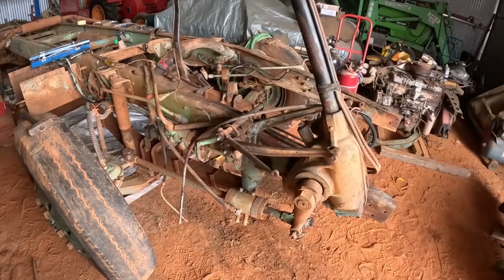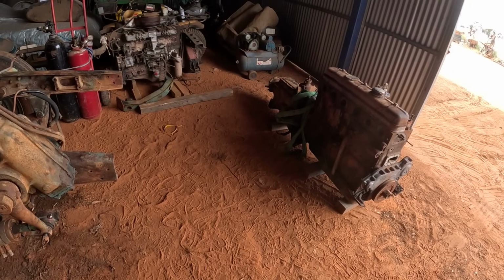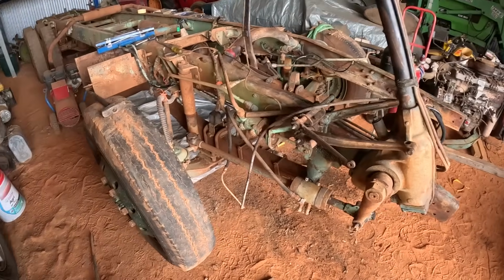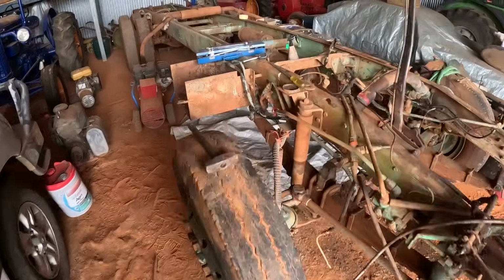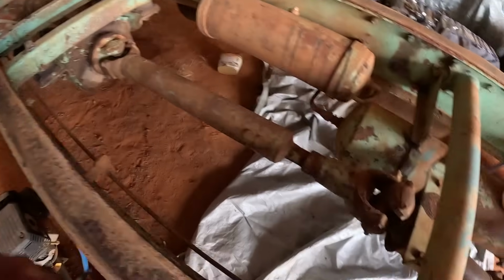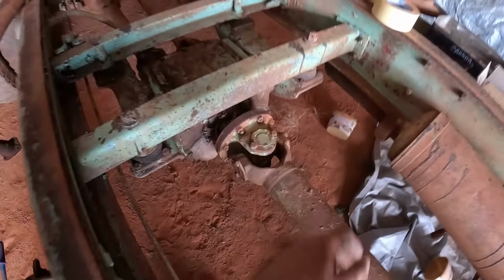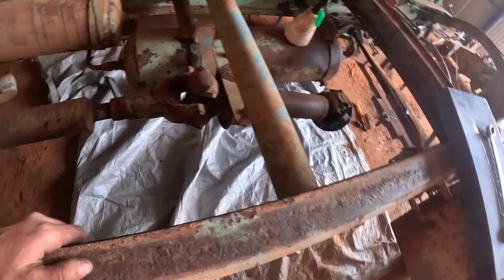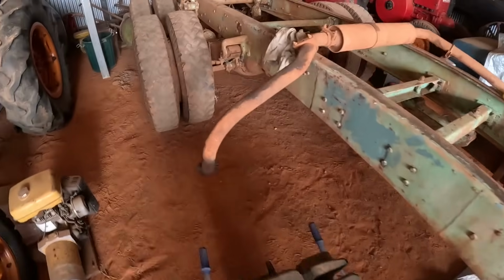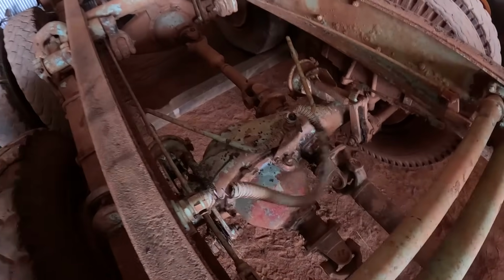I don't entirely know what we'll tackle next, whether we make that engine worthy of going back in the truck, or whether we just keep pulling this one to bits. Because obviously we've got lots and lots of things, like there's 9 uni joints on it, all that's got to be checked, and there's melted baling twine around where seals are supposed to be, and I've got to check the air receivers and everything, because all that sort of brake stuff is important. Obviously that's why we never had any brakes at the start.